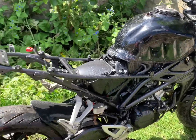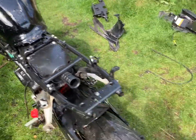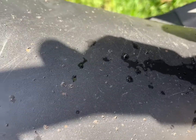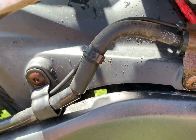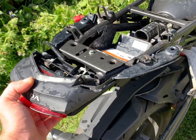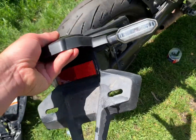When the bike's at its most stripped-down is the best time to wash it. I don't want to get water in the electrics, but I'm going to take a good bit of time and go around and wash this bike as I put it back together. Looking at this rear mud guard — it's got a lot of damage, like tarmac has melted onto it. I've got another one, so I'm going to switch them out. It's just a case of undoing two bolts on each side and replacing it. I'll also put on the rear section with the rear light and under tray.